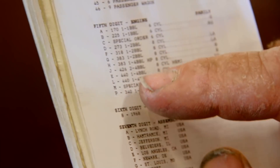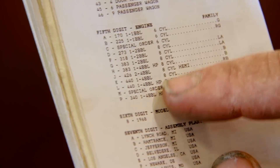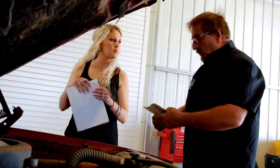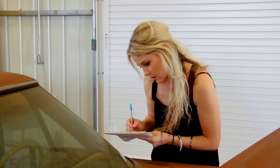The fifth digit of the VIN on this one should be an L — one four-barrel, the only way they made them. The eight represents the year, 1968. So the first thing we want to do is write down the full VIN number off the windshield: X, S, 29, Charger, L, 440, 8, B, and then the sequence: 2, 8, 5, 9, 6, 3.